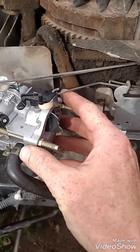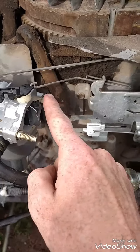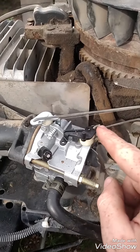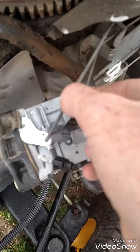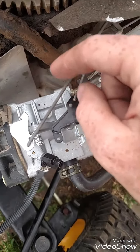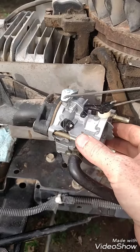There are two more bolts holding it on, so if I'm pulling on it, it won't pull off. You've got to undo these other two bolts and undo your linkages — make sure to take a picture or video. This one has one here, then it has two other ones: a little one, a little teeny wire, and a big one. Undo those linkages and pull this off.